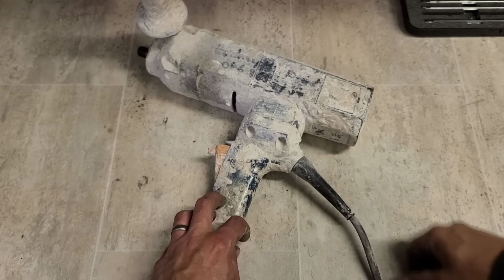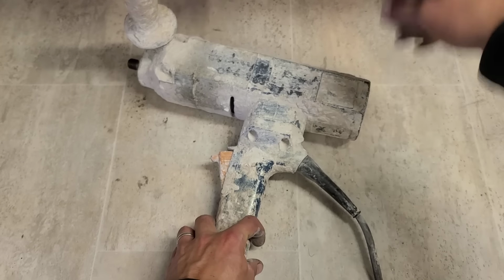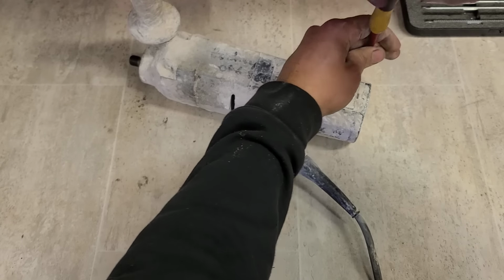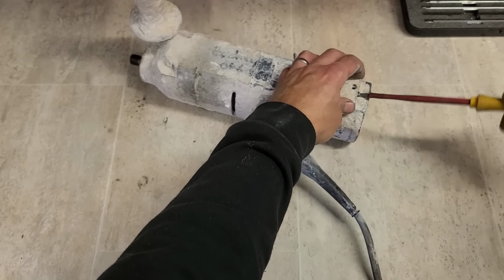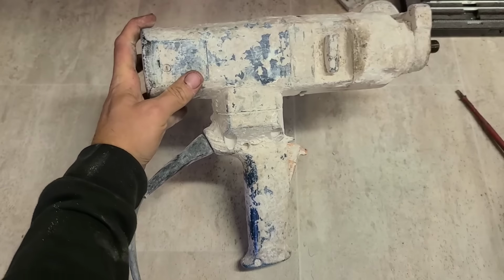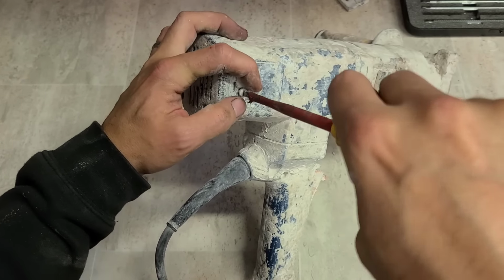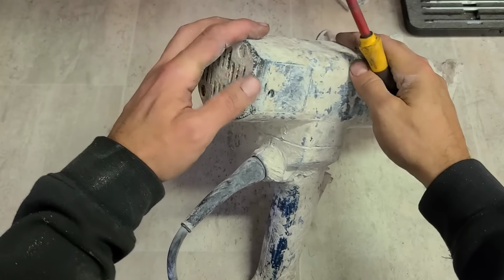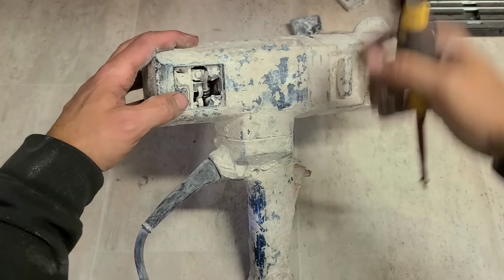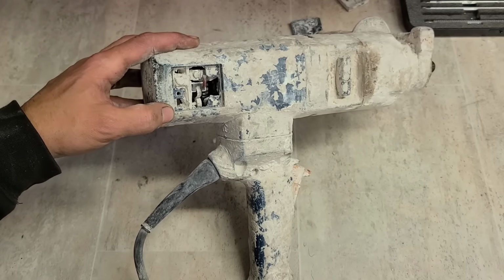So that, I'd imagine, is either going to be brushes or a broken wire inside somewhere, more than likely on the field. I'll check brushes here first. More than likely it won't be these, but just in case. That one's okay. Sometimes they can just start to stick in the holder. They wear down so much they lose contact, and once they're lying for a while or they get a couple of knocks, the brush just moves down then. But it's not that, they're moving free.